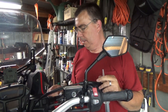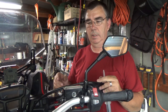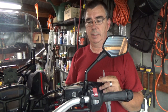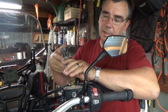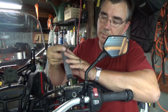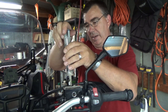I've got my brake pads on the right side installed and everything torqued. I'm ready to put my brake fluid back in here — I'll move my camera for a better angle. We'll go ahead and put the brake fluid back in — just like the rear, it should be exactly the right amount since it came out of there factory.